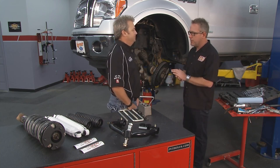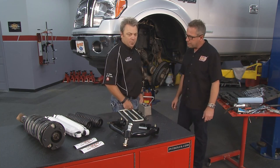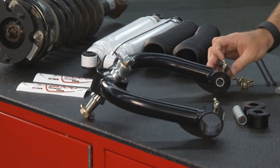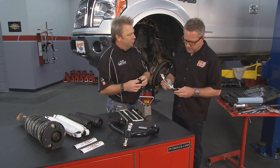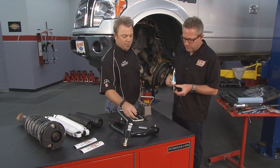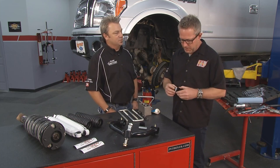The strut's all done and ready to go — now we're ready to install on the truck. First step is going to be the upper control arm. We need to install the upper control arm with the uniball system. First, we'll put the bushings in and grease them. If you take a look at the inside of this bushing, you'll notice they've got grooves in there — that allows the grease to run through to keep the suspension lubricated and working well. You want to always lubricate your bushings, probably as much as you change your oil.